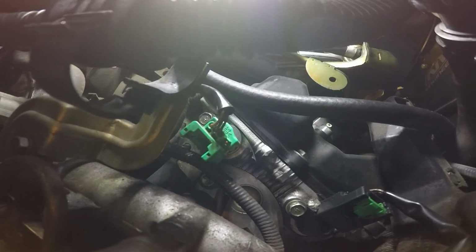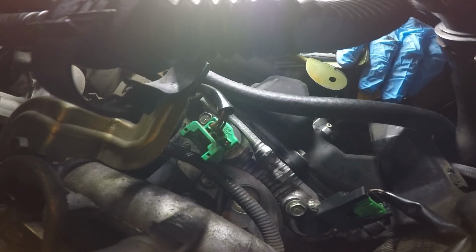And then when you torque this bolt down, I mean, you get it finger snug, and then just a couple turns. You don't want to over torque it because remember, this is a steel bolt going into an aluminum block.